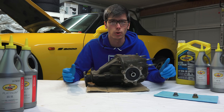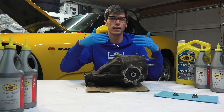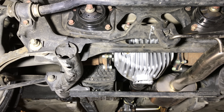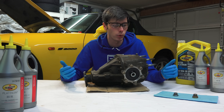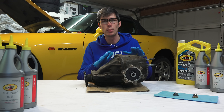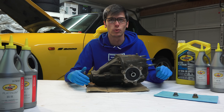Keep trips shorter so that thing can wear down gradually. If it starts to get hot, you're stopped by that time, and then you wear it down a little bit more as you continue driving later. Also, if it's a truck, you may not want to do heavy towing for those first 500 miles if you can avoid it — that way you're not putting too much heat into the differential or asking too much from it initially. Allow those components to wear down and find a good mesh before using the vehicle for its intended purpose.